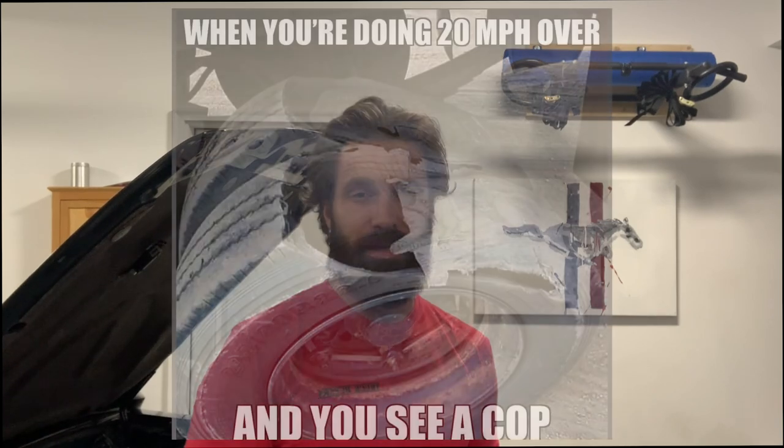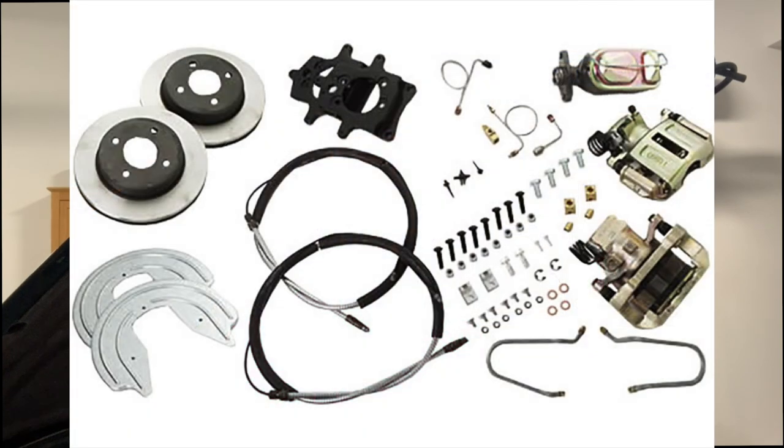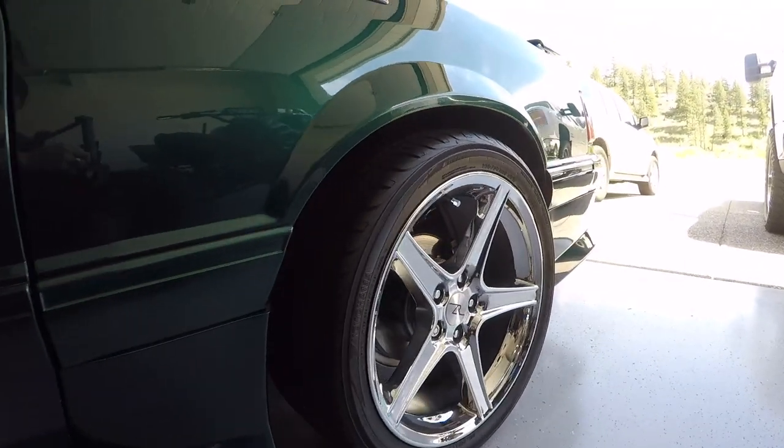I don't know how many cars like that are readily available right now, but it's just an option — saves you going to the junkyard or shopping through eBay. So, pros of a five-lug four-wheel disc brake swap: number one, sheer braking ability. There are ways to increase stock braking — steel braided lines, bigger front rotors, bigger calipers, more pistons, you can even get a rear four-lug disc brake swap — but that only checks two of the four boxes. You still don't open up wheel options or get the nice looks of a rear five-lug disc brake system.